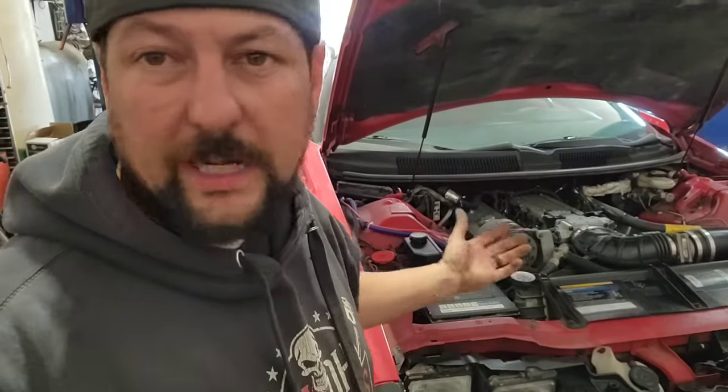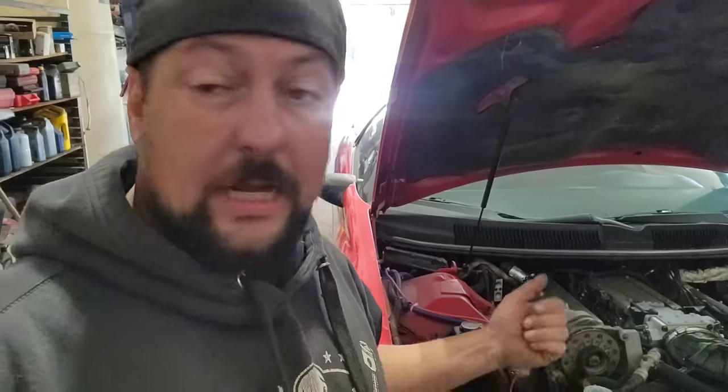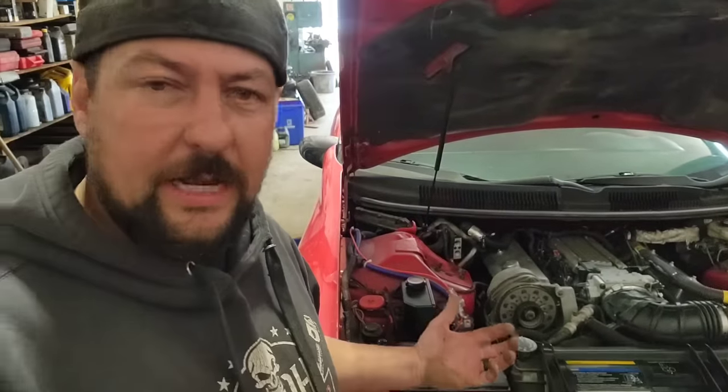I'm no expert and I've got no dyno to tell what the horsepower is on this, but common sense is common sense. I know guys can get 500 horsepower out of these things, but from what Skippy was telling me, it's naturally aspirated, it's a 355, it's not stroked or anything like that. It's got no power adders, and I think it's got 10 to 1 or 10 and a half compression ratio. To get 500 horsepower out of something like that, you'd have to be running a higher compression ratio and some pretty serious fuel. Pump gas 500 horsepower — I don't think so.